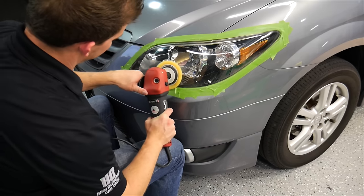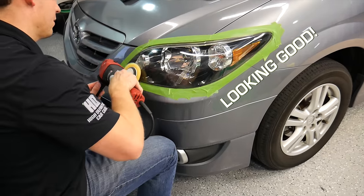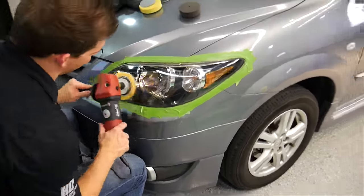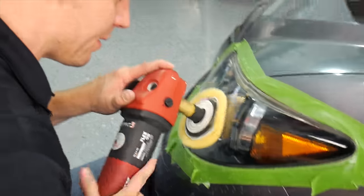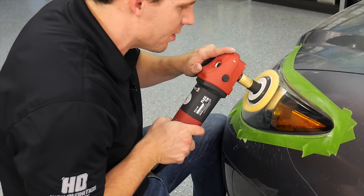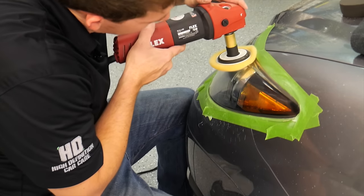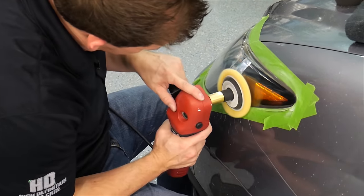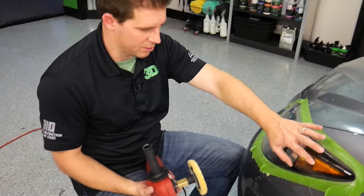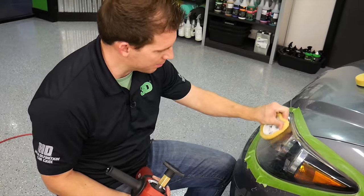Making sure you get all your work done. Now you can sand them quite a few times, but when you start getting into too many grooves, there's only so much you can do. They're very thick — a lot thicker than paint. Keep in mind, in doing this, there is some oxidation that's underneath the lights, some things that you're just not going to be able to get to. Those are things you're going to have to show to the owners of the vehicle. Now just like a car, you've gone through and compounded out the scratch marks with a wool pad. What's going to be left behind are some whip marks — wool pad marks.